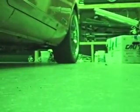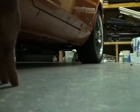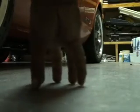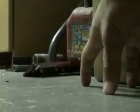In order for me to adapt, let me get to that later. Everything's fed by Walbro 255 also. But in order to run that with the Corvette reg, you have to get barb fittings. I can't find the pump. Actually, I think that's it right there. So I ran the tank, a generic fuel injection filter, the Walbro 255, the Corvette reg, and then it went to my stock hard lines, which went to the engine.